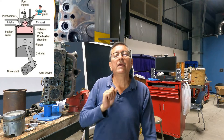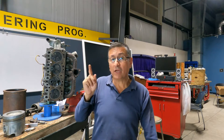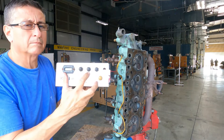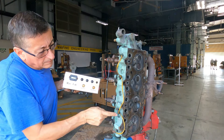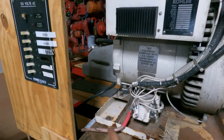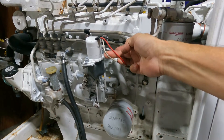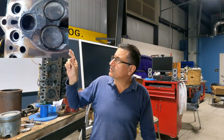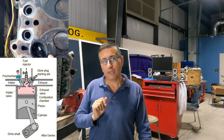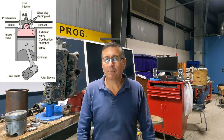Internally you can see the glow plug. In that area, the glow plug is located and the injector is also located. When you power the glow plugs — look at the glow plugs — they are located right there, connected with that yellow wire. In some cases it's a piece of metal. The yellow wire is powered from the preheat button on the console of the engine. The preheat button activates not only the injectors, but also the fuel transfer pump, the start-stop solenoid, and the relay of the cranking system. When you activate preheat — ignition, purple cable — you activate those elements and you activate the glow plugs. Look at the proximity between the glow plug and the injector — they are pretty close and located in that small pocket in the pre-combustion chamber. When you preheat the engine, that area becomes hot, and when you spray the fuel at the end of the compression stroke, the temperature will be the proper temperature.